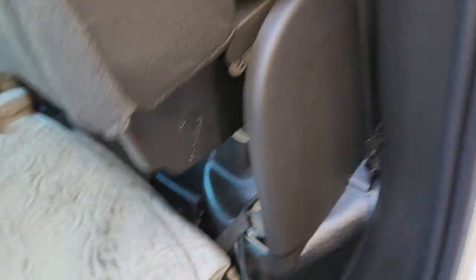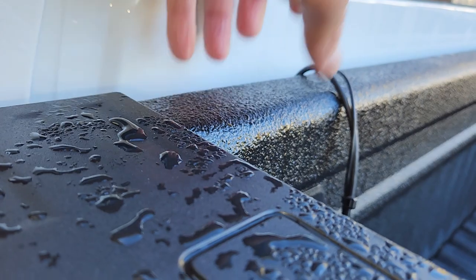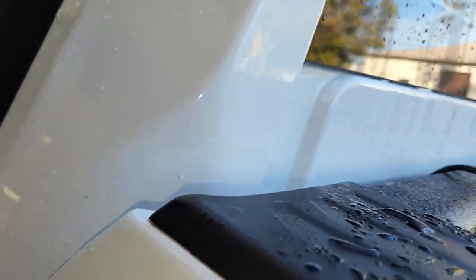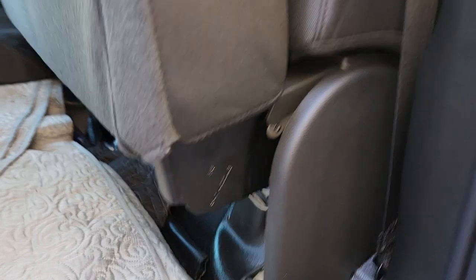In my particular application I want to make sure I've got a good ground, so I attach this — this is going to be a ground — I'm going to bolt it right there. I haven't figured out how I'm going to mount this; I think I'm going to take a piece of angle iron and put my mount on that somehow. That's why I need a ground, because this bed liner here won't make a good ground.